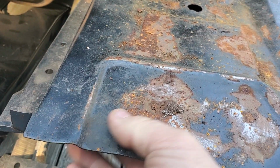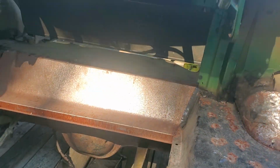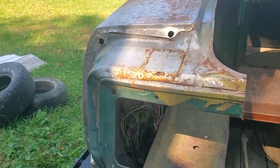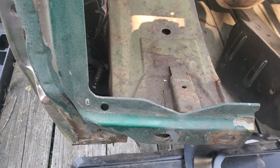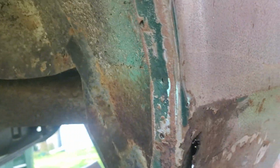So what they did is they welded the drop. Except it's not too bad. It's just not been welded good up in here. Took this off. This side's gonna have to have a whole new piece put in here and down. This whole piece is gone. Whole new rear filler. There's the drop for this side. I'm thinking it's gonna need lower quarter here, sectioned in.